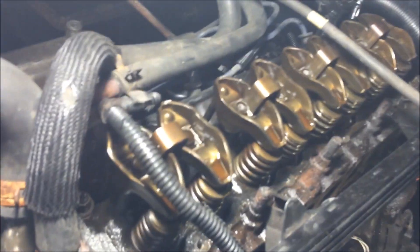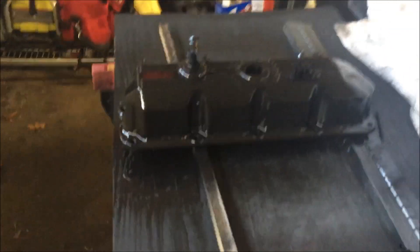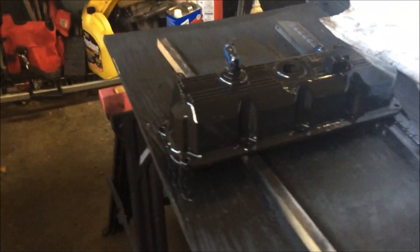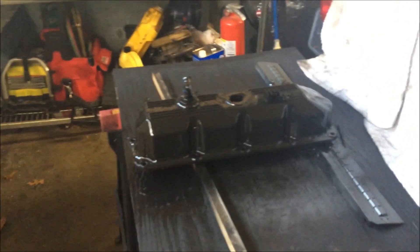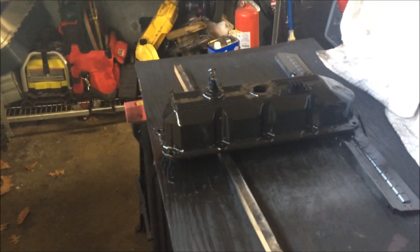One more quick update — it's the next day, Friday. I'm not spending much time tonight because I'm going out, but I pulled the valve cover off. Look inside — nice and clean, that's what you want to see. I got a helper today. Gave the valve cover a paint job with VHT Wrinkle Plus crinkle paint — I tried the crinkle finish on it but it's not crinkling yet. The can says it takes a couple hours to crinkle up. I didn't even bother sanding it down, just wiped the grease off. It's not a show truck — as long as it's painted and not peeled like it used to look.